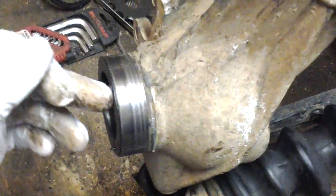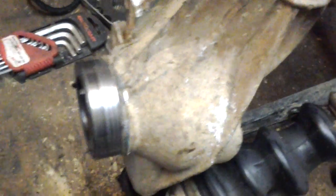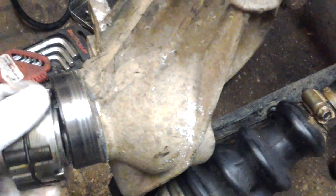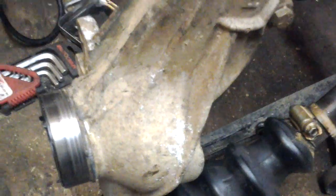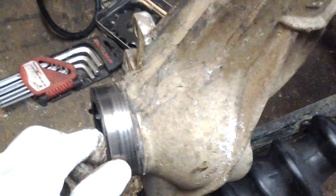This plate here actually acts as a braking system. A lot of guys on the forums were saying that they find some of these tabs are broken off. If these tabs are broken off, it's going to allow this clutch to spin all the time, so you're not going to have that four-wheel drive action — it's just going to act as if it has no actual power to it. Hope that helps some folks — I was real tickled when I figured it out.